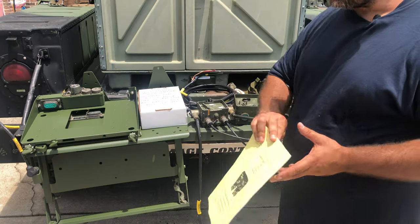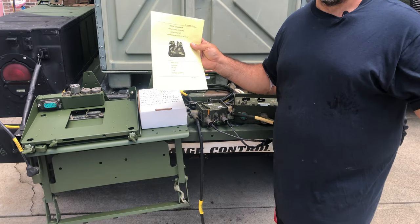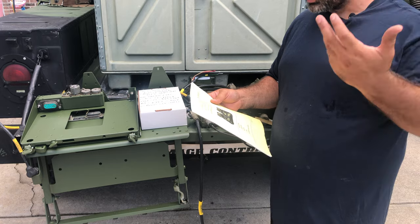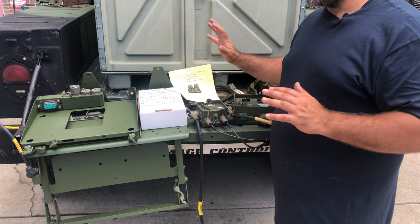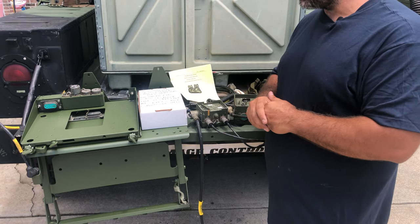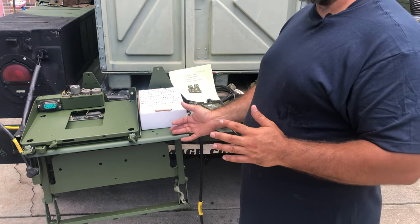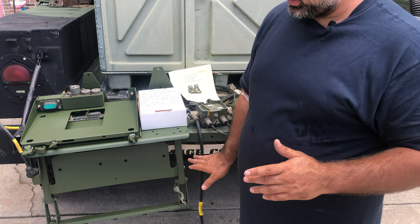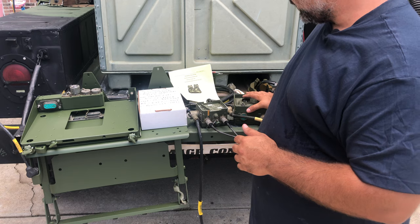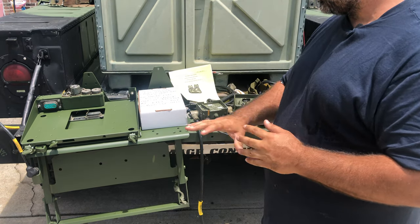Let's recap. You need your training manual — go on Google and search 'VIC-1 intercom PDF TM,' or the actual TM number is TM 11-5830-340-12. Download it and read it — you'll have more accurate information than I've shared. Everything I've shared is intended to bring you up to speed and get you started, not to be all-inclusive. You need a radio tray — any version works. You can get a basic one without the faceplate and use angle irons, or buy the more expensive one with the VIC faceplate and mount directly onto that.